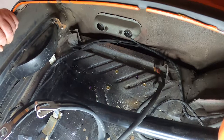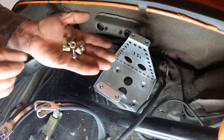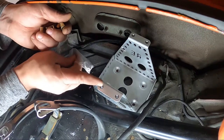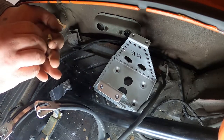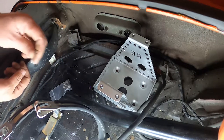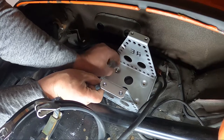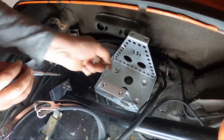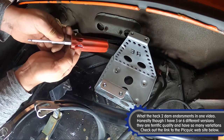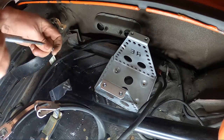So that's nutserts — pretty darn simple. As you can see from the bottom side, they mushroomed out perfectly. Now let's test fit this and see what it does, make sure we got it right. These did not come with this battery tray — it did come with the proper ones for the top. But these are from a kit that I never used for light bars. These are handy things. I've got half a dozen of the darn things, and a really good interchangeable bit — this one is for hex or allen keys.